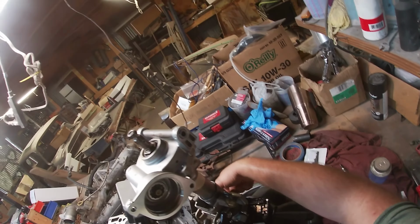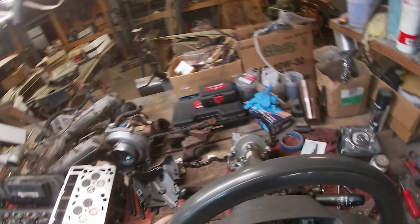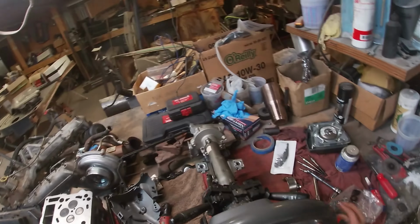Saw that, you just take something, you push in here, see these little release tabs, oop, it goes directly in. You just press on these from in these little holes like that, and you're pressing on this bar and it moves that bar over, which sits in this little lock here. See, you just push it out of there so you can pull it out. You can do one side at a time like I just did, or you can press them both at the same time if you're real skilled, which is what I tried to do and failed.